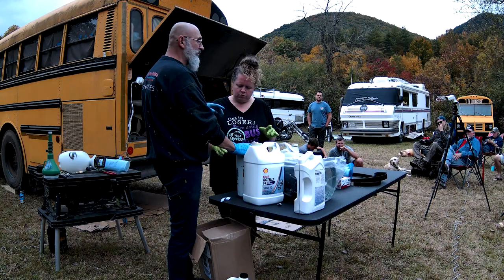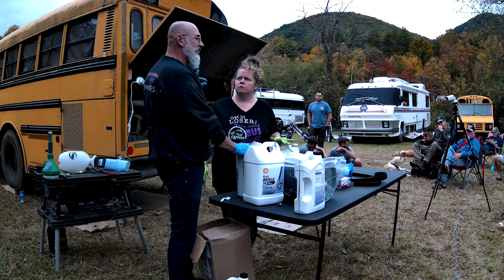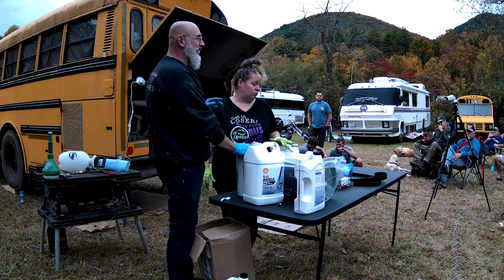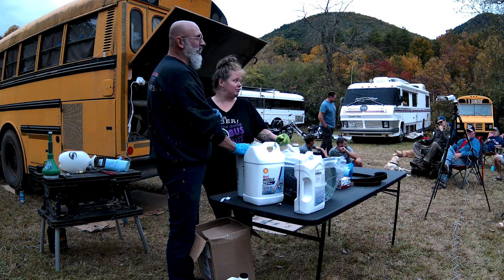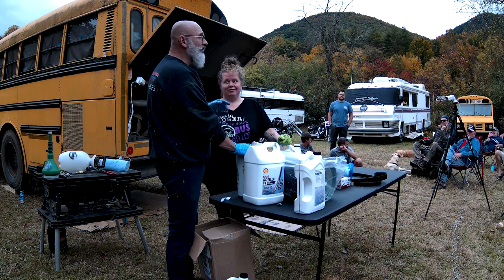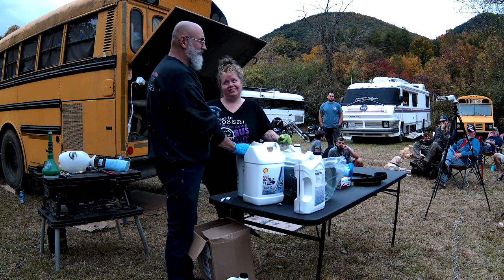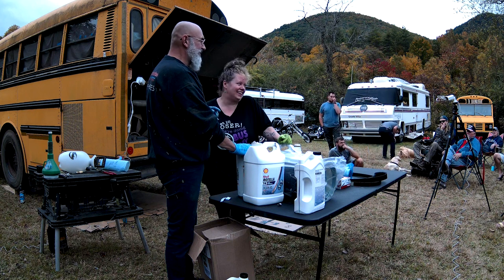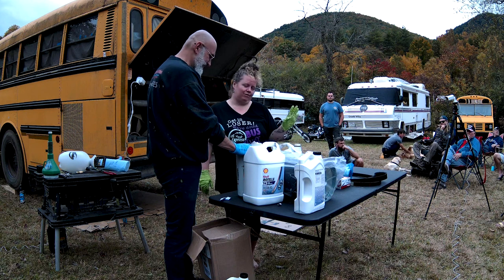And speaking of which, we did a pre-inspection on Mo's bus before doing this, and her air dryer. Everybody who has an air system has an air dryer. Air dryer, not hair dryer. Yeah. The air dryer on her system, someone wrote on it the last date it was changed. January 2015. Oh, that is something that should be done on a yearly basis. Oh, so 8 years have been missed. Very old.